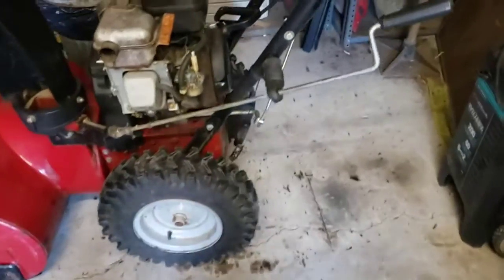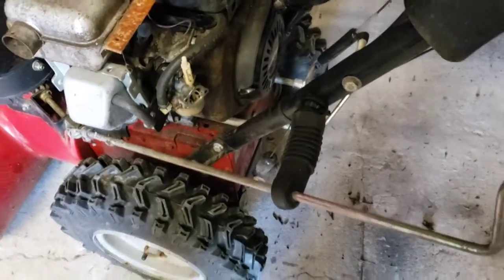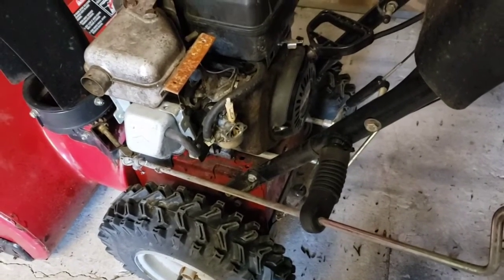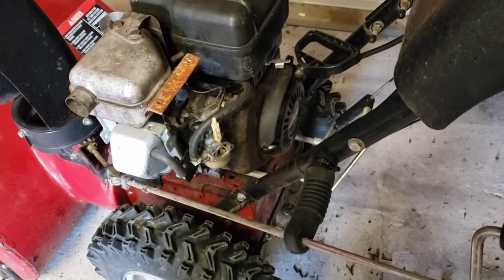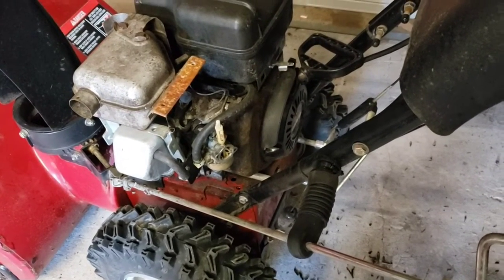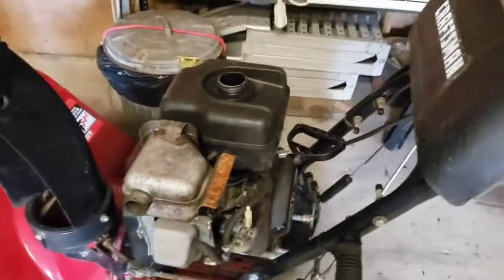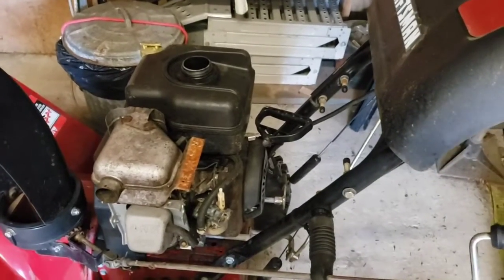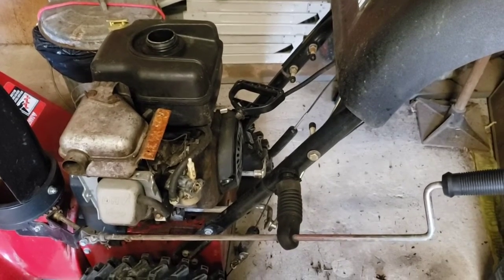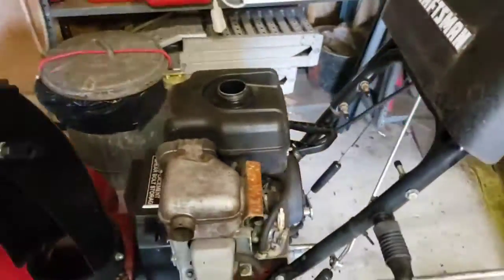Alright, we get that carburetor put back together, back on the blower. She definitely needs a carb. The seat is shot inside the bowl there for the needle to sit against off the float. So she's shot. Put the gas tank back on. Just reassemble some parts here off camera so we don't lose anything. But anyway, it's what it is. We'll have to search for a gas cap. We'll load up a new carburetor. They're usually not expensive. You gotta do what you gotta do.